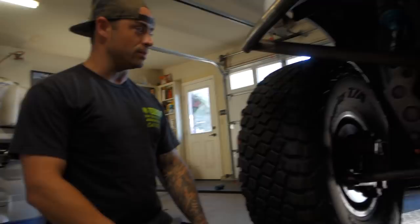Back to you, Darren. So, biggest benefit, affordability. Anyone can build these. They're available on a lot of junkyard trucks that you could find. The other thing I think with beams that is important is there are fewer moving parts. So that's why that bulletproof aspect kicks in, where there's not as much stuff moving on them that's going to fail, something's going to bend, and you're replacing stuff.